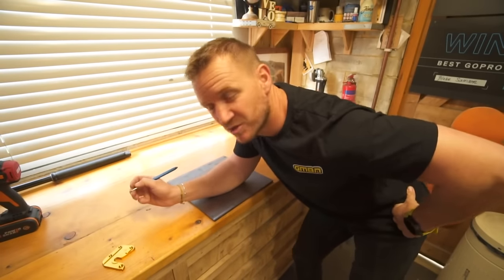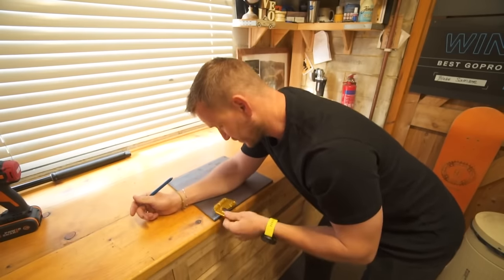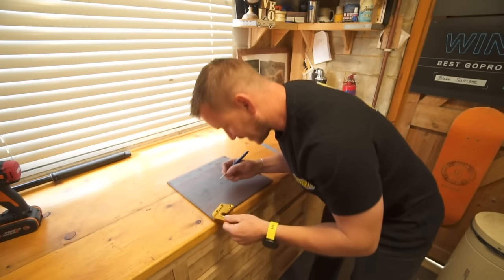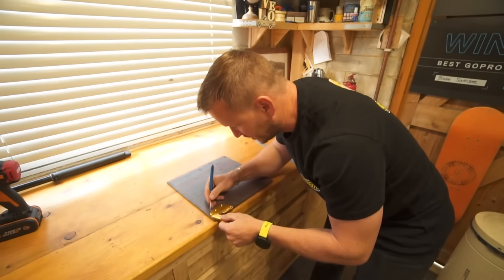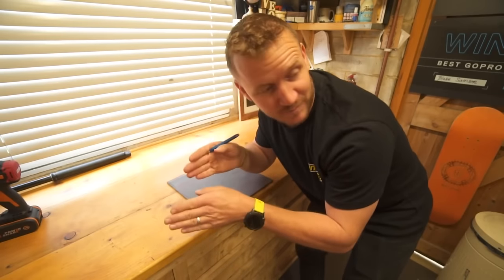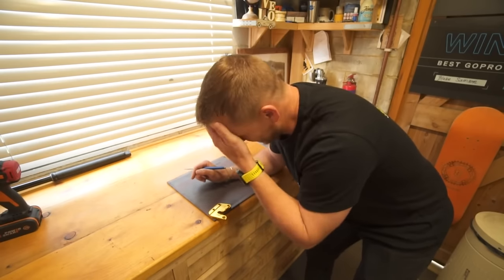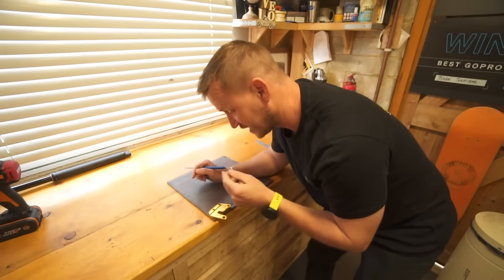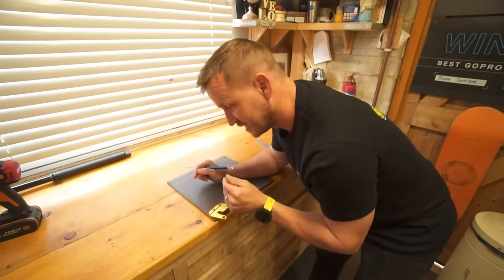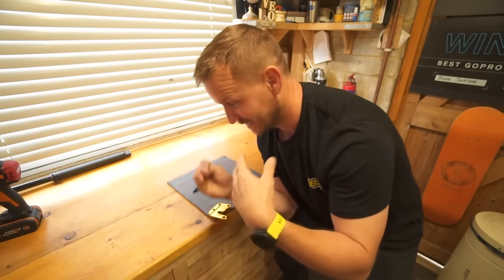Okay, the next step is the rear triangle, but before I start cutting the tubes and trying to bend them into place, I'm gonna make the dropouts for where these are gonna bolt to. I've got this 6mm plate, I'm gonna trace around this, and add a little bit of steel up here, and probably some bits like this, so I can weld the tubes to it. This part here is gonna be the easiest part, to be honest. I just gotta cut two exactly the same. The hardest part is bending the tubes. It's getting really hard now, and I thought the front triangle was hard.